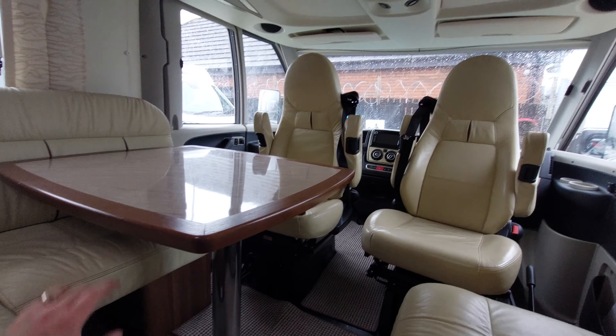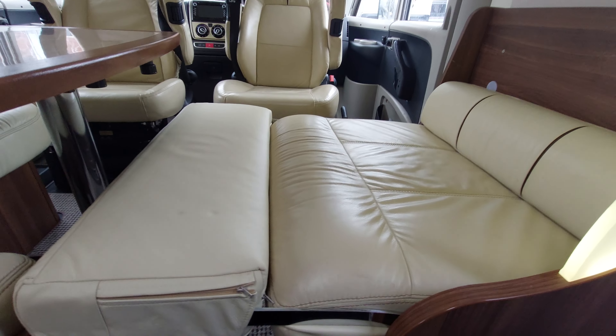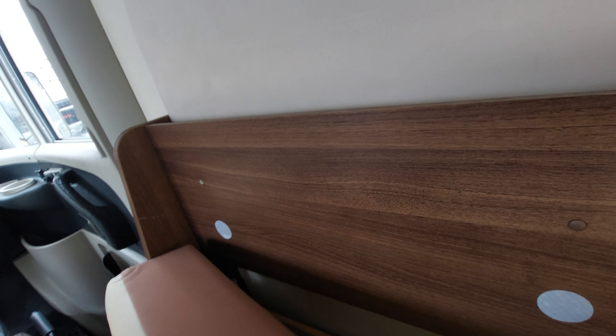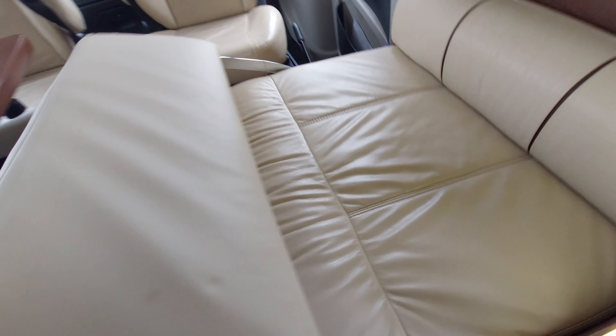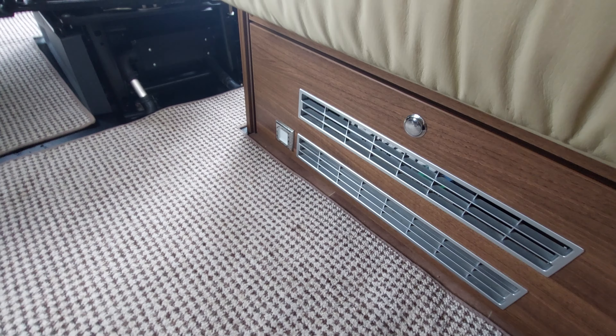The table will move all the way across or sit in the centre for the living area. On the opposite side you've got a reclining system — pull that down to give you a bit more room. Move the headrest just there when going back. Underneath this side seat, press the push button at the top and that's where your leisure batteries are located. There are also a couple of fuses there — check that if you're unsure about any power loss to the batteries. There are two batteries on here as standard and you'll need to change them both together.